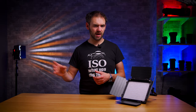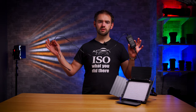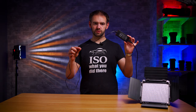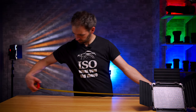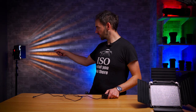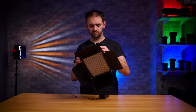Or you can use it as I've generally been using it, which is with mains power. And this is where we come to problem number one for me with this panel, which is the mains plug. You have a fairly standard heavy duty power cable that runs from the mains to a transformer box, then a thinner cable that runs from the transformer block to plugging into the light. Except this is not particularly long — less than four foot. If your light is anything more than four feet off the floor, this plug is essentially dangling in mid air, which is what is happening right now. Even with a 90 degree connector, this is surely putting unnecessary strain on the power plug.